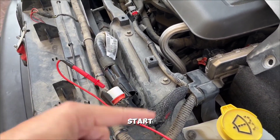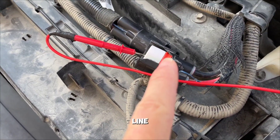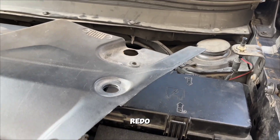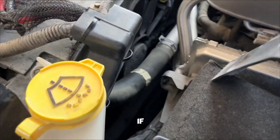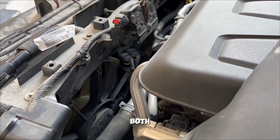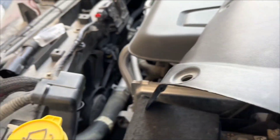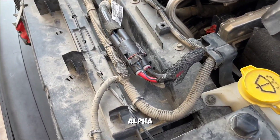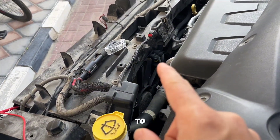What I'm going to do now is reconnect this line to clear up the P0480 error. I'm going to redo this test and see if the fans will start, because if you trigger the fan radiator cycle using the Alpha OBD it's supposed to trigger both fans, not only one — that signal means turn everything on. So the line is now connected; I'll clean up the errors using the Alpha OBD and trigger the cycle again, expecting to see both fans spin.